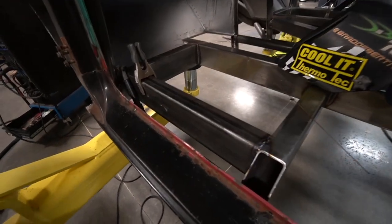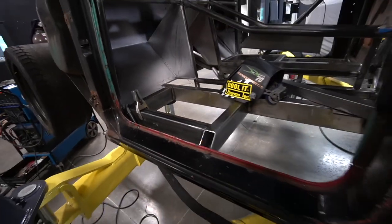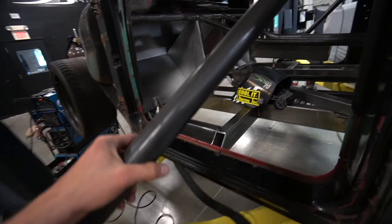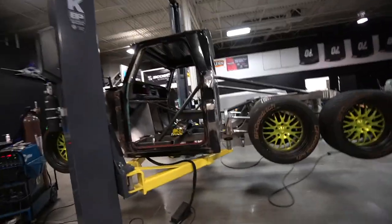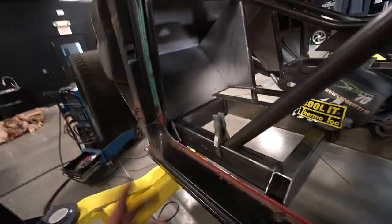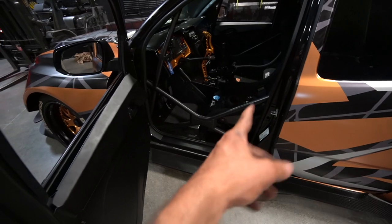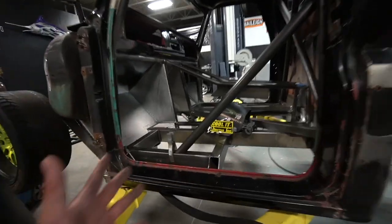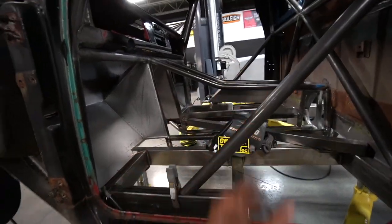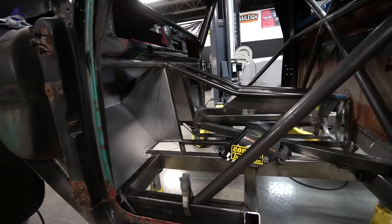The floor is out and I still have one piece to add right here — I ran out of material so I put that on order. I wanted to show you guys what this door bar is gonna look like. A lot of people on a full race car like the Tacoma spec would have an upright coming off of it for full triangulation, but on this one I don't want to make it a pain to jump into the seat, so I left 12 to 13 and a half inches here so you can get in super easy.